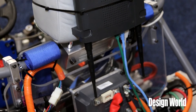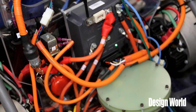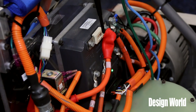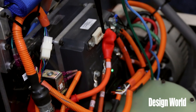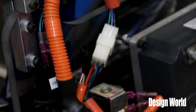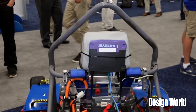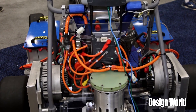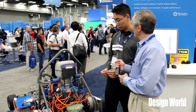The purpose of the flywheel is to improve the regenerative braking efficiency of this hybrid electric vehicle, and the design was based primarily on safety factors. Outside the flywheel is a large aluminum casing, and we did FEA analysis along all the bearings and all the parts of the flywheel. For most electric vehicles, standards recommend at least a 4.1 factor of safety, but based on our tests and calculations, our flywheel has a factor of safety of 5.3. That was basically the motivating factor behind every single part of the flywheel design — just safety.